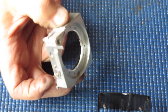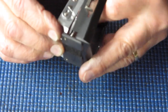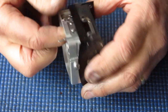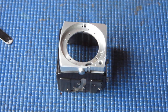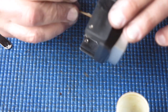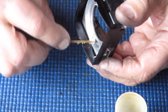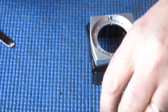That's good. I'm holding those two buttons together and I can slide the front of the shroud over the top of that. And that just pops out — that's how they latch in position. This pulls in and they just latch in. I'm going to apply a bit of synthetic grease to this section, some on the rail top and bottom, and some on this plate where these two buttons ride, as you tend to get a bit of friction there too. That's running nice and smooth.